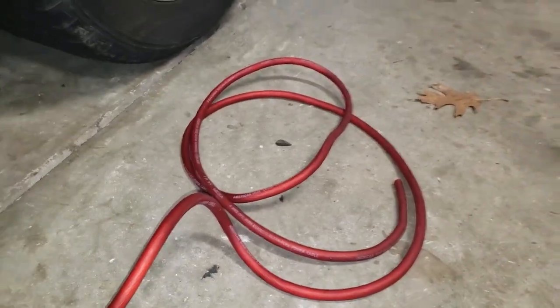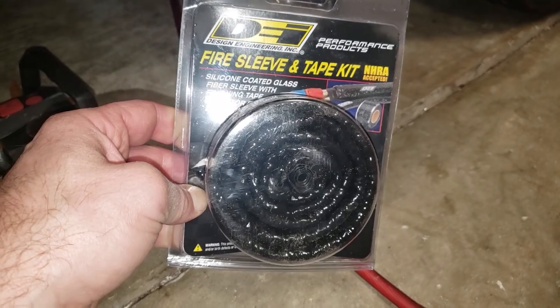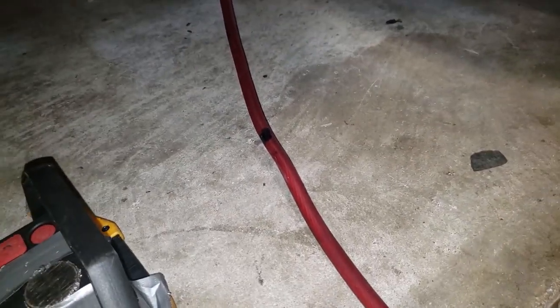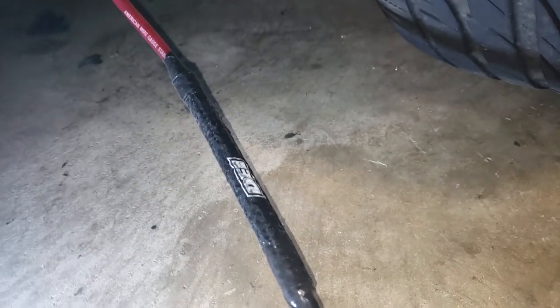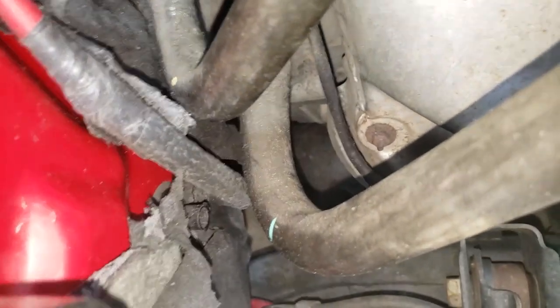I had to pull the wire back through the firewall. This mark here and the other mark show the six-inch path that's going to be super close to the exhaust and heater hoses. I'm going to use this DEI fire sleeve and tape kit — cut off about six or eight inches — and slide it up the wire to cover that section, then reroute the power wire back through the firewall. I'll have peace of mind knowing I protected this wire. The manifold is right there and the wire is now protected.